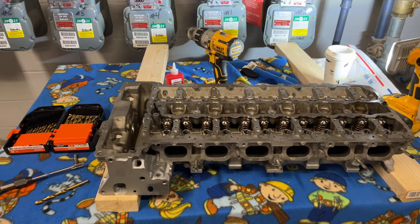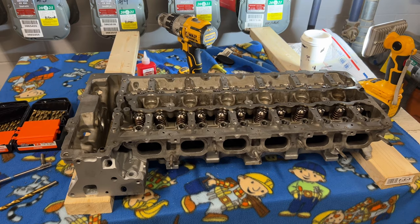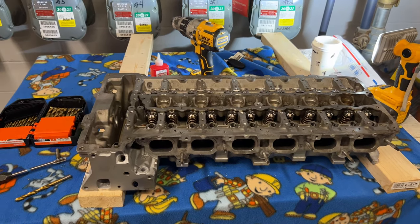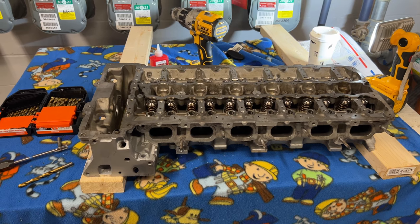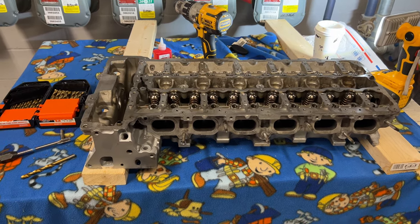I'm aware that Nexus and MHD are coming out with port injection only, but you're still going to have issues at high horsepower, as far as the DME throwing or sensing false knock. And at high horsepower, you're not really commanding the DME to do something. You're kind of asking it and hoping that it does it.